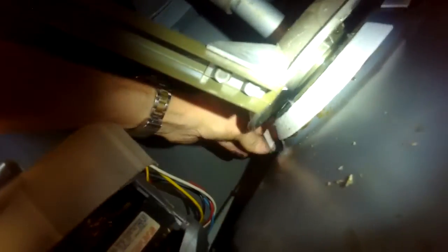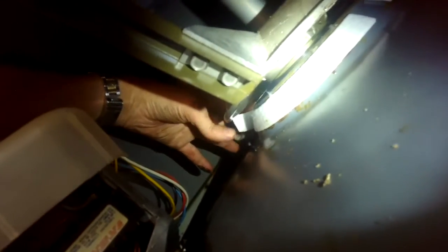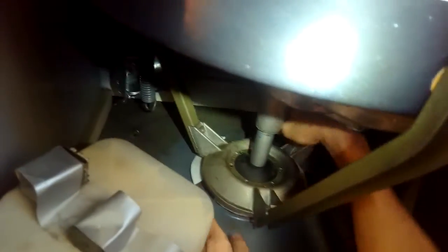You want there to be a little gap at the top of about 1/8 of an inch to 1/4 of an inch between the top of the damper pad and the top of the metal rim. You can kind of see in the video it's about 1/8 of an inch to 1/4 an inch. Doesn't have to be exact. The next damper pad will go on about 1 inch to 1.25 inches away from the first one. It's going to be the same technique. Same with the third one, about 1 inch. You want to have them be as equal as possible to form a nice ring. They won't touch though. There will be a gap in between them of about 1 inch.